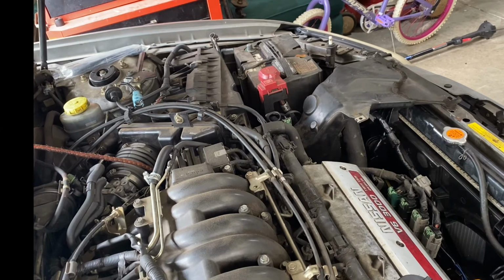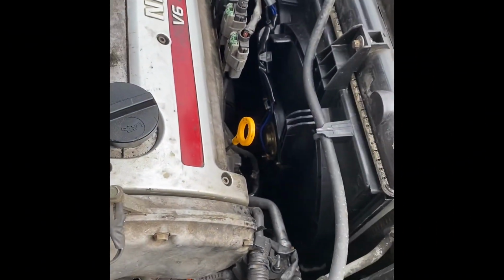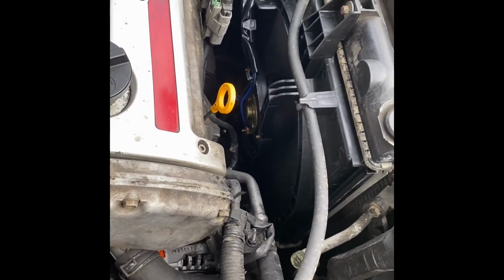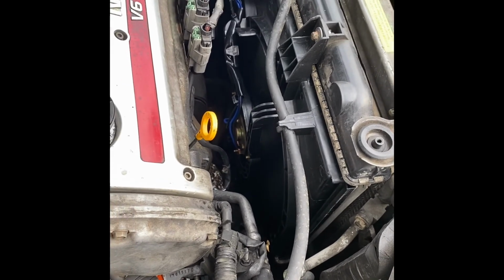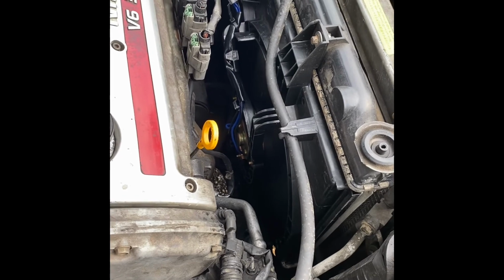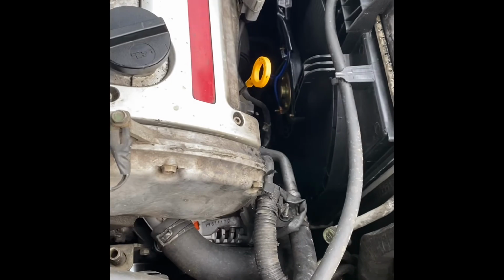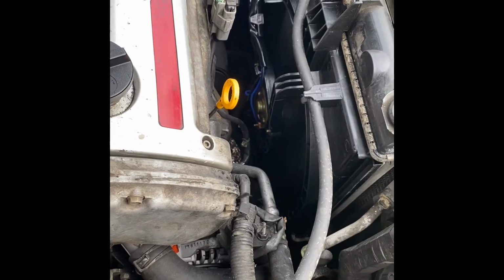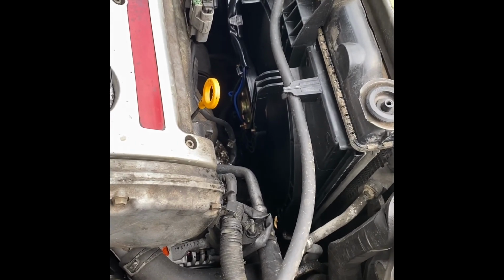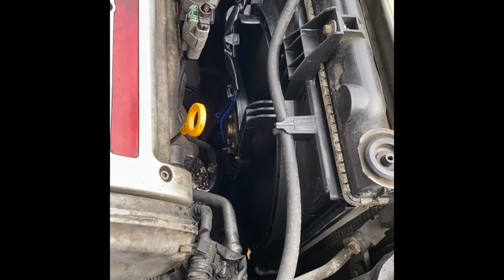This is pretty much done. Well, we got it all fixed here. I did have some electrical problems. One of the fuses had also blown. Apparently the old fan had gotten bad and was taking too much power, and that's what caused the fuse to blow. And that controlled this fan. So if I had just put a fuse in, it probably would have blown again. My neighbor helped me figure that out. But yeah, I did need to replace this here, the radiator fan assembly.